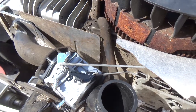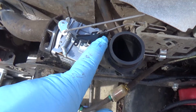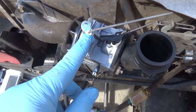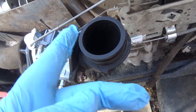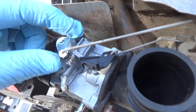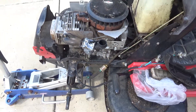The spring wraps around down under here, so just try to make it so it's not overly wrapped around the cord. Again: the choke goes in the first hole, the main throttle cable goes through the white connector facing down, and the other one faces up. The spring goes in the second hole — that's how you hook up your throttle cable linkages.